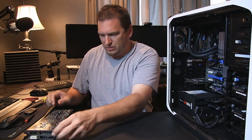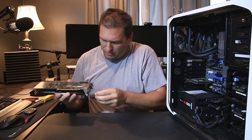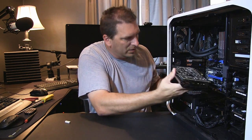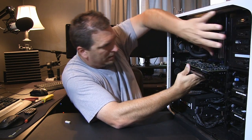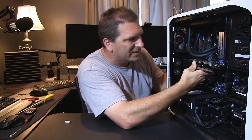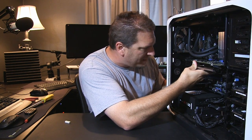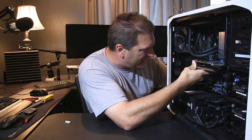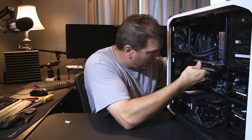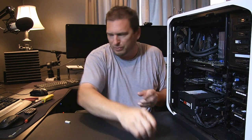Now we're going to take this card and install it. I use one HDMI and one dual-link DVI for the two monitors I'm using here. Watch your cabling when switching things out like this — it can get in the way. You want to keep an eye on the PCIe slot, make sure all the teeth are lined up, everything's lined up on the end, and push it in until it snaps in place. There's a little lever you can check to confirm it's fully seated.